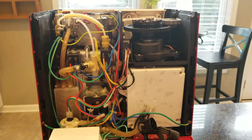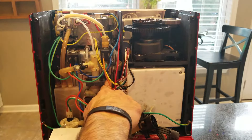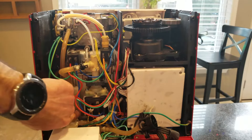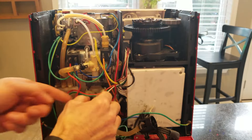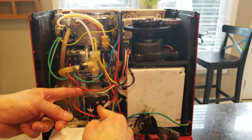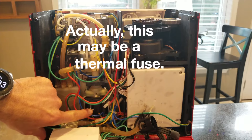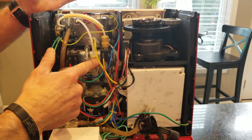With the back of the machine wide open, this is where the water inlet is. We need to remove the screw here and here, which holds the upper mount, and there are two screws just like it right below. We also need to disconnect the electrical connections here for the pump, and then pull out the temperature sensor that's over on this side.